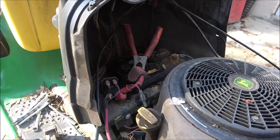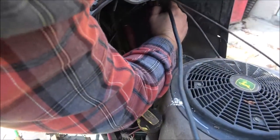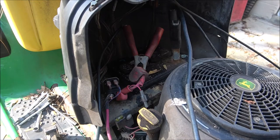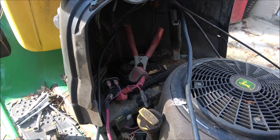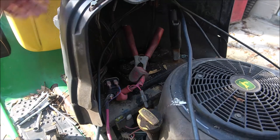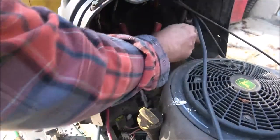But like I said, when I put a new battery in, it's getting all new. I may put new cables on it, but I may not need them. Go ahead and put this on here. I want to kick it up to just 40 amps. That should be enough to crank this. I'm not going to have to put a 200 amp boost, but let's try it. Well, maybe I am. Last time we started it, the battery was dead because it sat for a long time. And I just ran it around front and back around here, and it kept that charge that good. Yes. There we go.